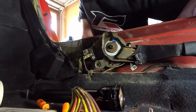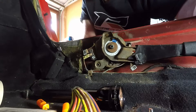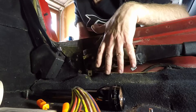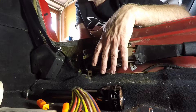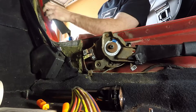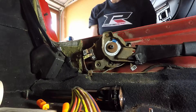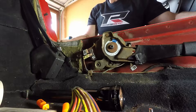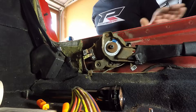This was quite a process. It requires removing the seat and the cover for the parking brake. I found it so much easier just to remove the sill. Two screws — take this off, two screws here. There's some sticky adhesive on each corner, so be careful prying it up. Take the sill plate off.